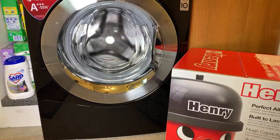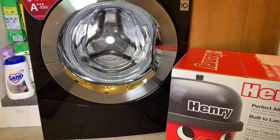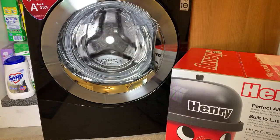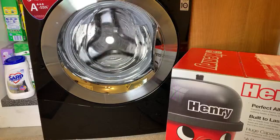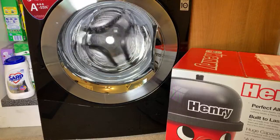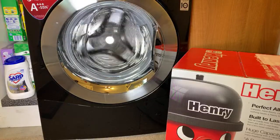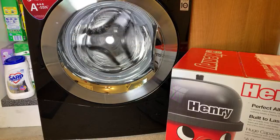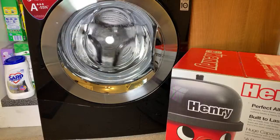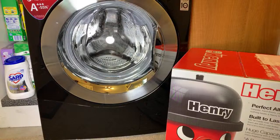Probably because you selected rinse and hold instead. But don't tell me it's going to spin. No, I hope not. It just says rinsing. It's supposed to be rinse and hold. Dorian, can you please message me on Instagram after the live and explain to me, please? Yeah, I will, no worries. Nightkiller, what will happen if it spins? It's not like a vortex to the end of the world, but it has balancing balls in there to help it balance with a load. So if you haven't got a load in there, the balancing balls literally make the machine unbalanced.